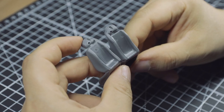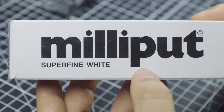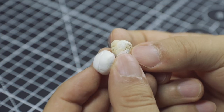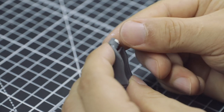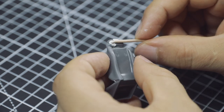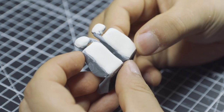In this case the seats are missing a chunk of plastic in the back. You can fill in the missing areas with putty — I usually use Milliput, which is a two-part epoxy putty. It's easy to use: just mix two equal parts together for a few minutes, then fill them into the holes. You'll have about 40 minutes before it hardens, which is plenty of time to work it. Don't worry if you don't have any putty — you can just leave it as is, since you're not going to see too much of it once the seats are in the car anyway.